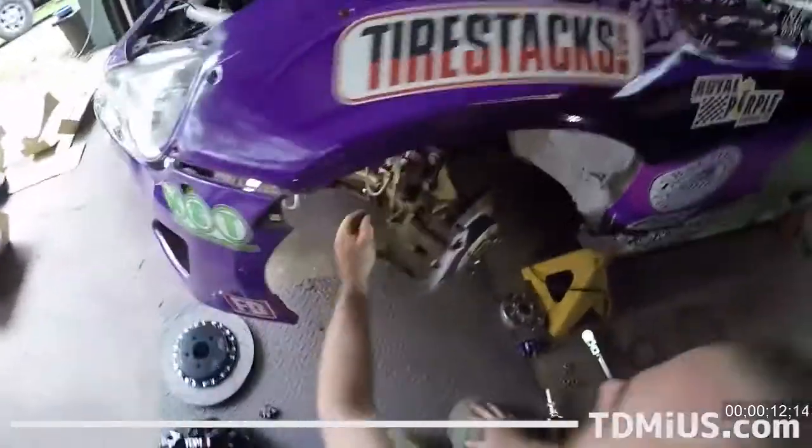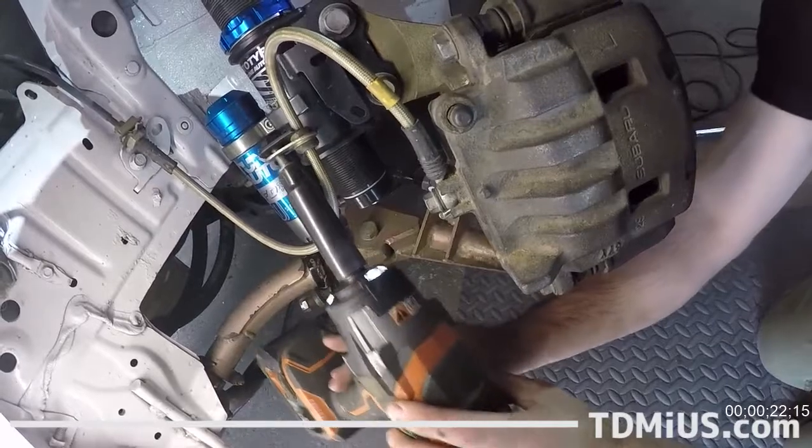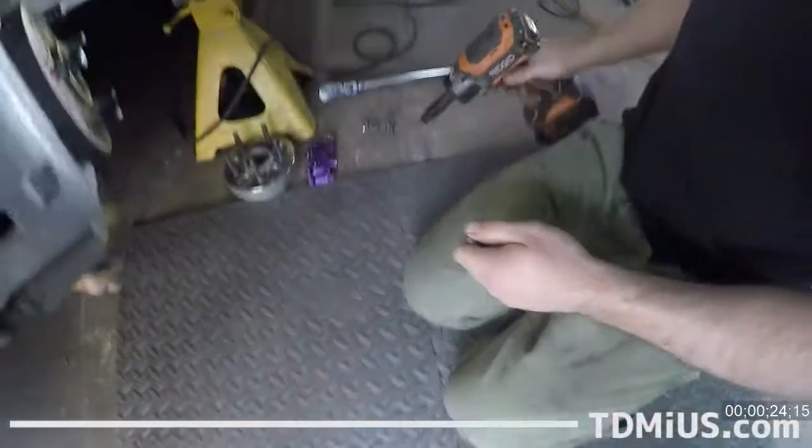We're off. We're gaining access. We're getting in there. Okay, so what's next? I'm gonna take off this brake hose, because I'll forget if I don't do that now. The one right on the back side here? Mm-hmm. Bolts right to the strut. Heck yeah, 10 mil's gone.